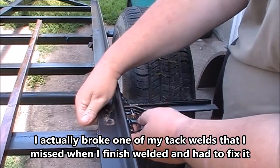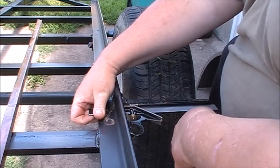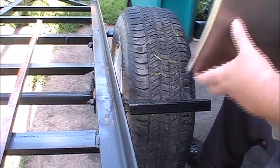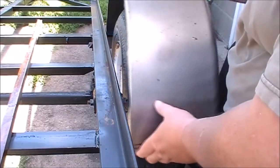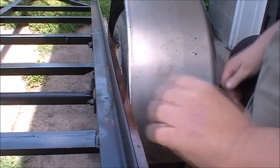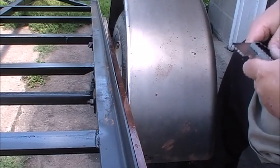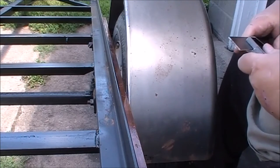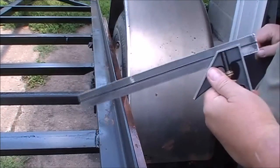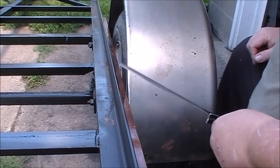Now that I have this a little better, we can put the fender on. I'm going to put a board back here that's three quarters of an inch wide so that I can push my fender up against it. I'm going to set my track square here at an inch, which is not an arbitrary number — this is three quarters of an inch and this is a quarter of an inch, that's all we got: an inch.